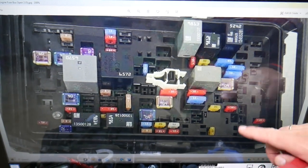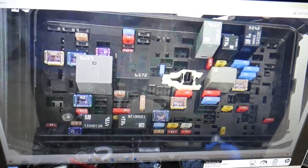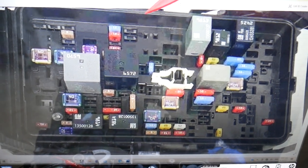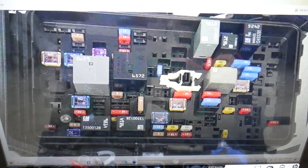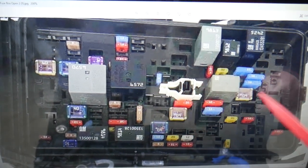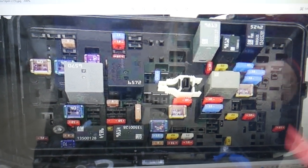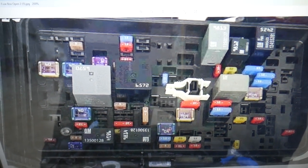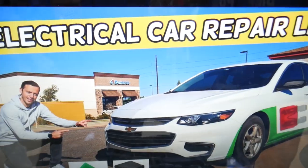The transmission pump relay — not all Chevy Malibus will have that relay. This is mostly for the hybrid vehicles, so some will not have it and some will. If you have problems with your transmission you may have five or six different kinds of fuses and five or six different kinds of relays. The relay we need to check is known as relay 42, and if you have it, it will be that relay right there. Hopefully this video has been helpful — thank you for watching and see you next time.